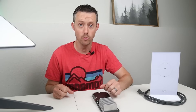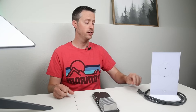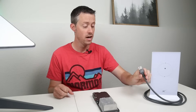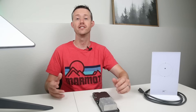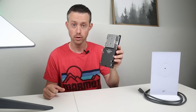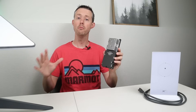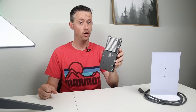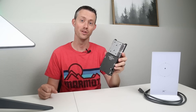Now what does that mean? Well, anybody that's familiar with Starlink Gen 2 knows that it has to be powered from an AC power source, which means that you have to run an inverter if you're in a portable setup, which leads to extra power usage draining your batteries even faster. Well, that's where this product comes in. This is a plug and play solution. There are no modifications that you have to make to this setup to run it off a 12 or 24 volt battery. This is really cool.